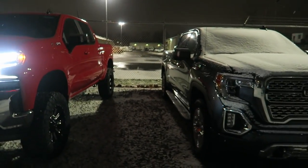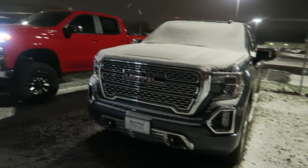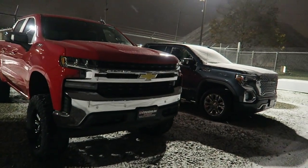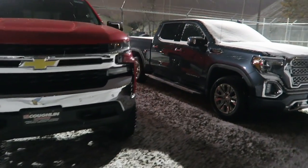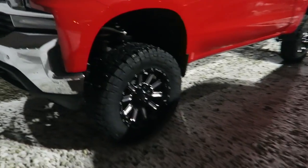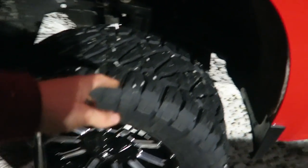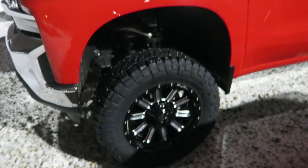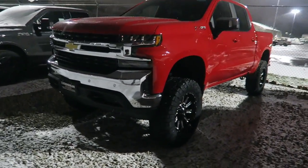Here's a quick comparison — here's it next to a stock GMC. Obviously it's pretty much the same truck, but man, that six-inch lift and the 35s really brings it up. That makes the truck huge. I'd like to see some offset on these Silverados though. I mean you can't fit much — these 20x9s are rubbing already. It's not been aligned yet but it hits that mud flap, so you're going to need some trimming if you go any wider or bigger. Not the most ideal wheel well, but this thing with some stance would look pretty mean.